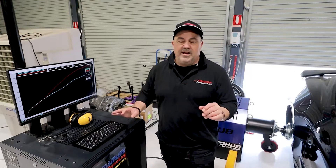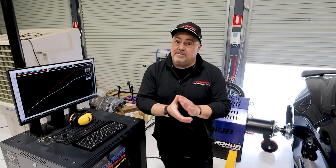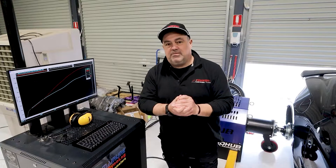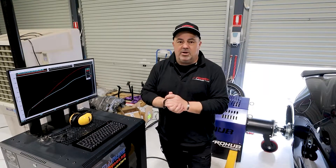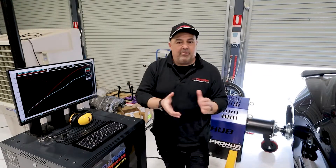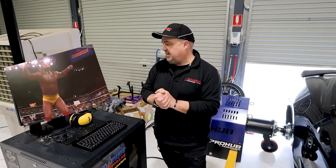Here we have it — the results are in. See that run, she's a little bit smoky — you know why? Because it's paint coming off the brand new exhaust. It's only had about five runs, because that's all it took to get it in the sweet spot, right in the meat of the power curve. Standard: 427.8 kilowatts at the hubs, so we lost 50 through the drivetrain, which is about right. Tuned up: 556 kilowatts.